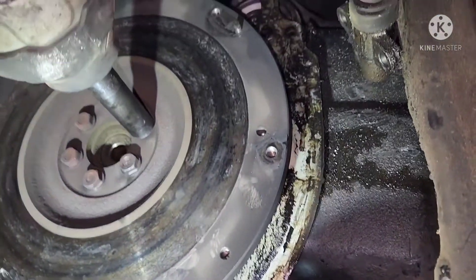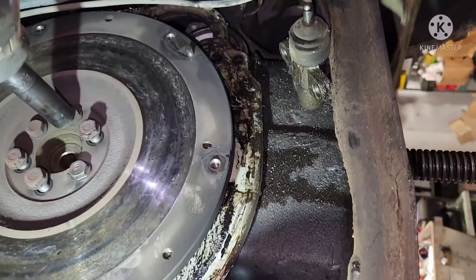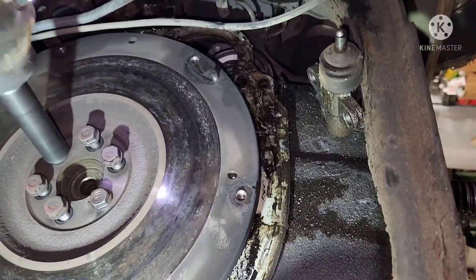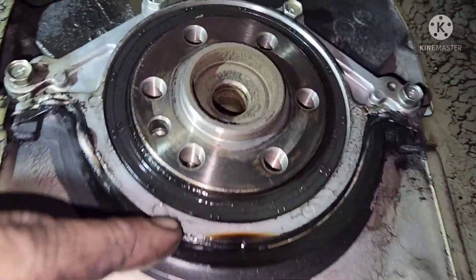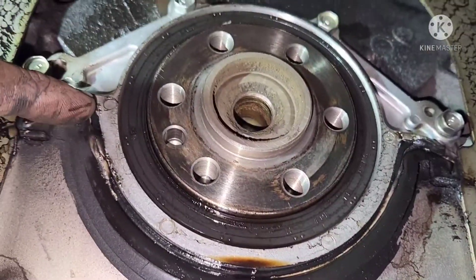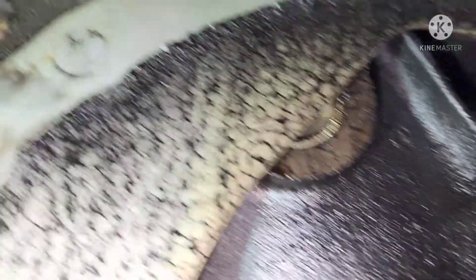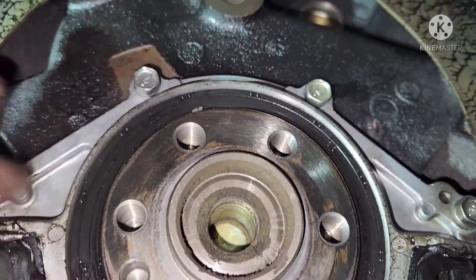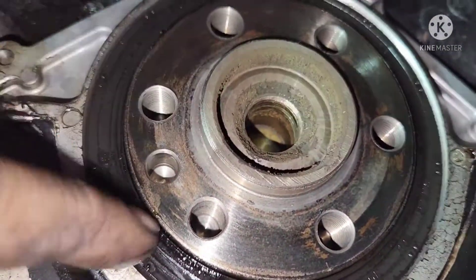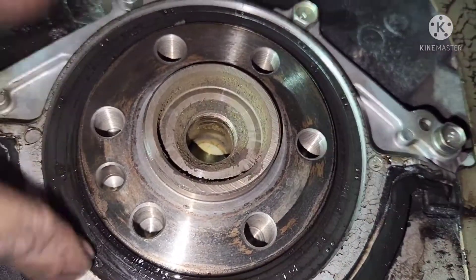We're blasting this off - it's 14mm. You can see in the video there's oil accumulation down here. I'm going to go ahead and replace this rear main seal because it does look like it's leaking. You have other possible oil sources from up above, but it would be stupid not to replace it if it looks like this with oil accumulating - you don't want to have to do this all over again just to replace this seal when it goes bad. It's not critically detrimental losing a little oil, but you don't want to lose a lot all at once.